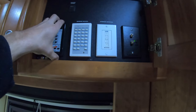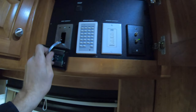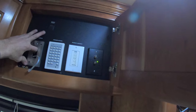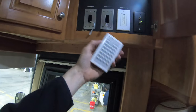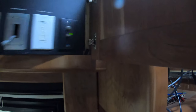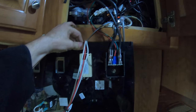I wanted to show you this before getting too far into taking it off. This on-and-control panel is magnetically held on. Always unplug it first because the port on the back here can get damaged and ripped off — I've had to solder it up for other audio video technicians. Then you can unplug the blind control. I don't bother taking the brass catch off; you can just rotate over it and pull on it. It's got a little aftermarket velcro — make sure that doesn't catch — then you can pull this out. There's a plug here for the override; we'll tape this up in the corner to let it hang.